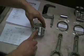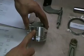Just so that you know, when the rod is attached to the piston, which bore it goes to. The next thing I like to do is refer to a build sheet with all the clearances labeled out — it's several pages long. The first thing on the build sheet is the piston diameter. Using our machinist micrometer, I'm going to measure the piston at the widest point on the skirt, which is half an inch up, which I've already measured.